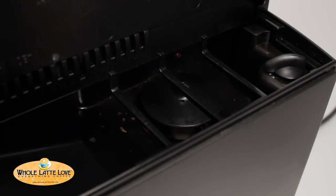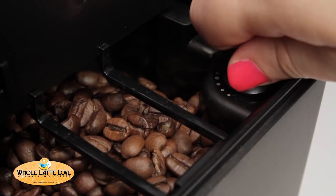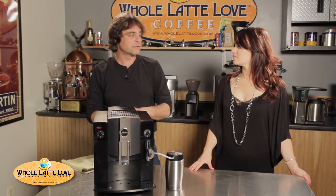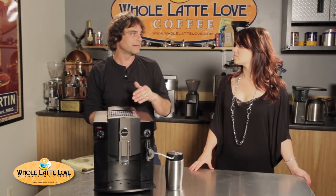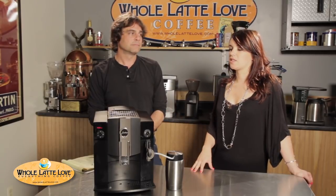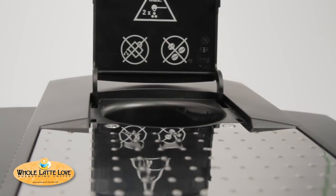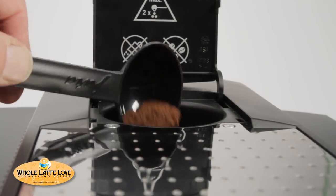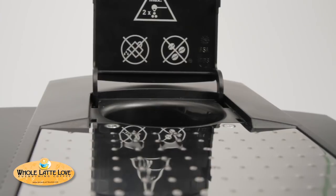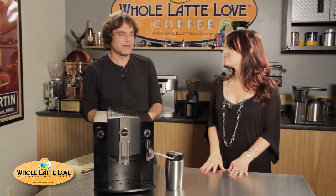On the C9 we have an 8-ounce bean hopper, a conical burr grinder, and six grind settings. Use the finer grinds for lighter coffees and the coarser grinds for darker coffees. With Super Automatics, you want to make sure you're not using really oily, dark beans because that has the potential to cause problems. The C9 does have a bypass doser — it's a maximum of two scoops, and there's a dedicated button on the front that you'll want to select before you put your coffee in. If I need a quick cup of decaf, I can use my pre-ground in there — but that's not for beans, just for pre-ground.